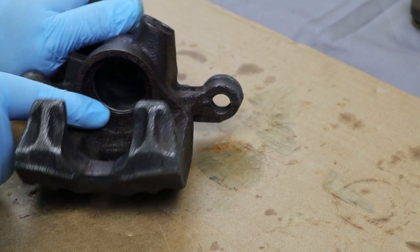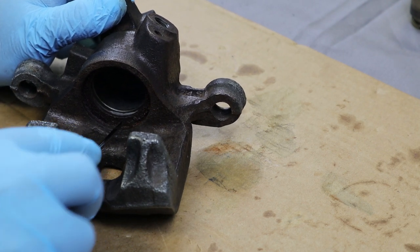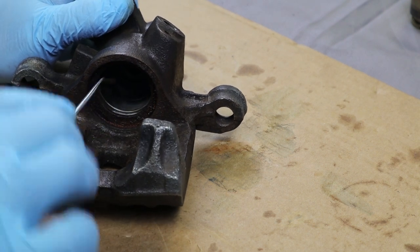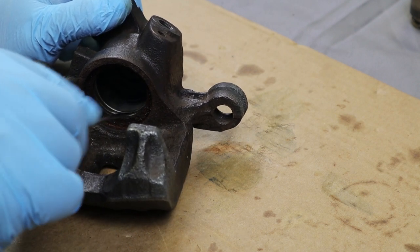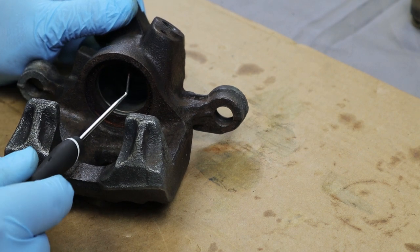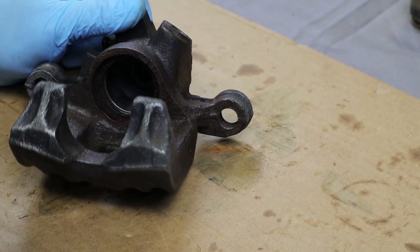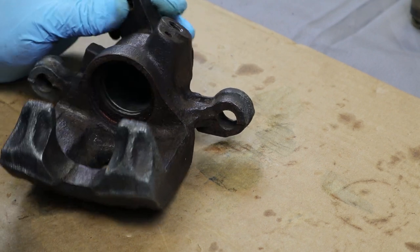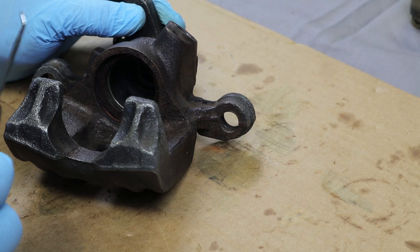Down inside the caliper it's pretty nasty and rough. I'm going to use my pick tool to clean around the inside edges and corners since the rotary tool won't reach those areas well. Then I'll use the rotary tool to buzz out as much of this rust as possible — that's a lot of what we did the other day. After that I'll have to go back outside and clean everything again with more brake cleaner. I'm putting on my respirator and safety glasses before getting started on that.